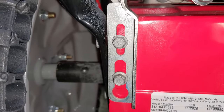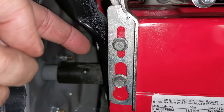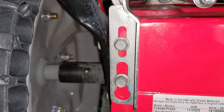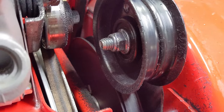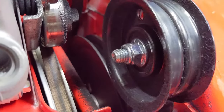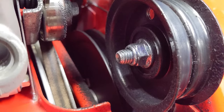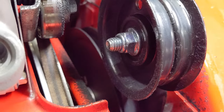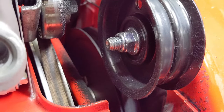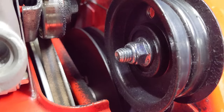For the auger cable, there is a guide bolt and a bracket bolt that holds the bracket against the chassis. By loosening that bolt you can lower the bracket, which will pull the cable tighter, applying more tension on your auger cable. Be careful not to adjust the cable tension too tight, because the cable pulls on the idler arm, and at the bottom of that idler arm is a small bracket that acts as a brake. When you let go of the auger lever, the brake is applied and stops the impeller pulley from spinning. If you apply too much tension, it will start to bring the idler arm in, which can disengage the brake. Make sure that when the idler arm is completely released, the brake on the impeller pulley is fully engaged.